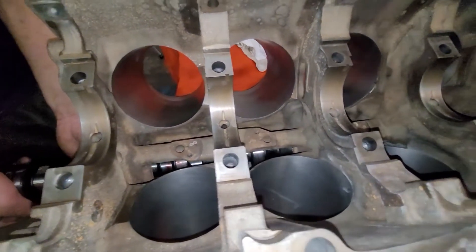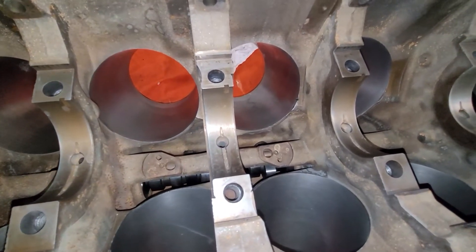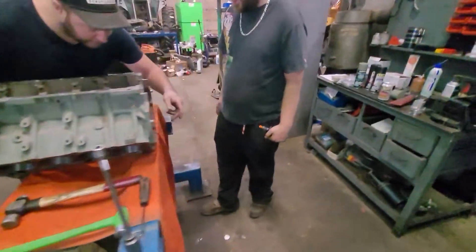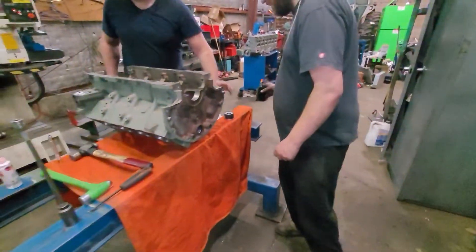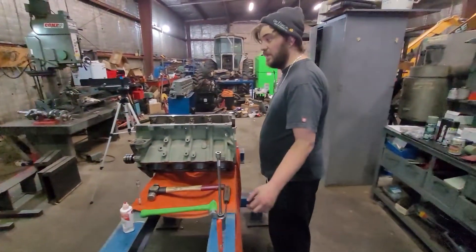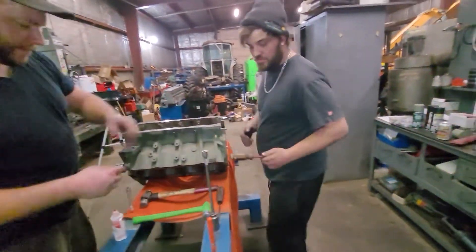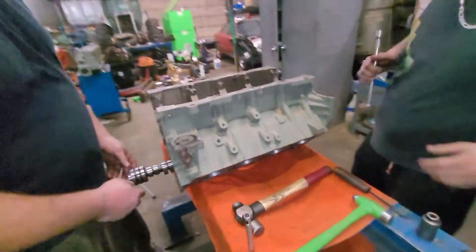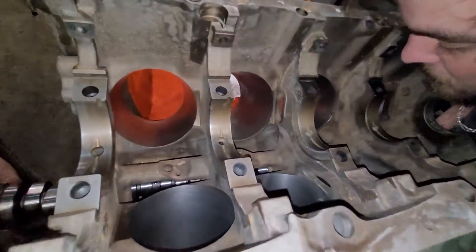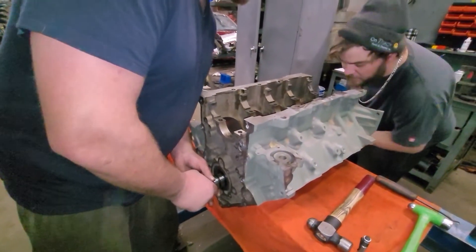Right now I'm keeping the pressure downward with my right hand, just trying to feed it through until you get farther up there. You can normally have an assistant reach in there, or if you can reach all the way around you can do it that way. I think we'll get Kyle to reach in there with a long screwdriver or some such device. A lot of guys will have a threaded rod that goes into them too, but I've seen lots where they've gotten damaged - sad day. If you're building the same engine all the time you can get more specialized tools.